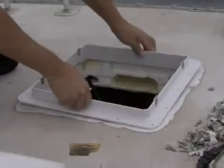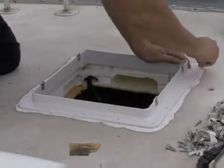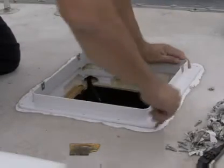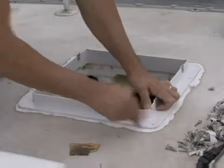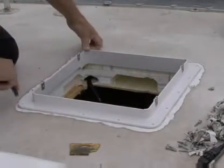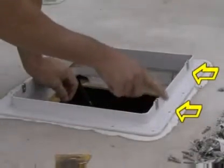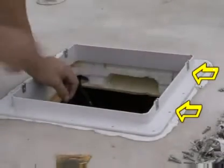Place the Maxx fan roof receiving flange into the roof opening and trace a pencil line around it to verify the clean seal area that will be required. Note that the roof receiving flange must be centered in the roof opening with the metal clips facing the sides of the vehicle, not facing the front or rear of the vehicle.